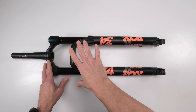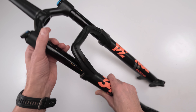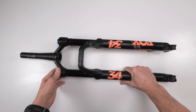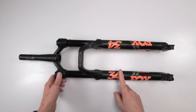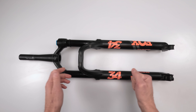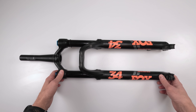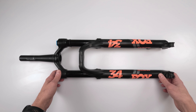We are going to be doing the full air spring and a full damper service. The difference with this fork is it has a remote top, so that will be something different. The damper bleed on this fork is going to be slightly different because of the year - this is a 2018, so we'll have to do a bit of a different process than the previous fork, which was a 2021 Fox factory.